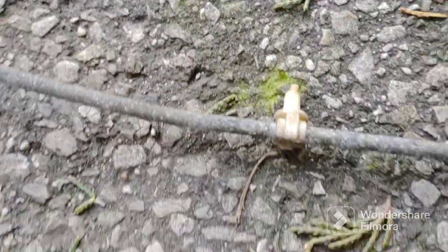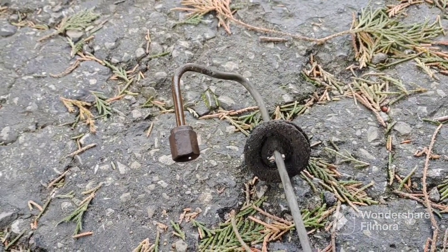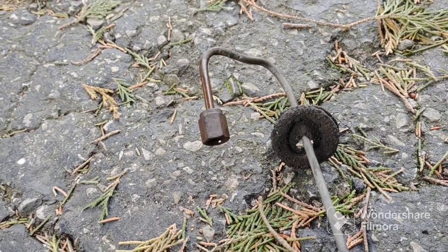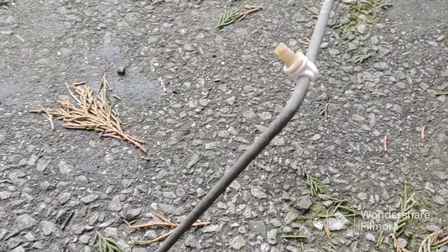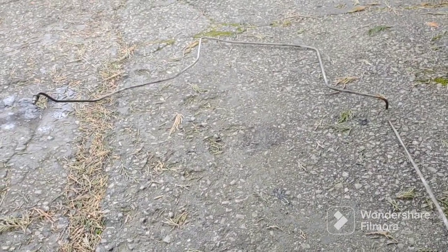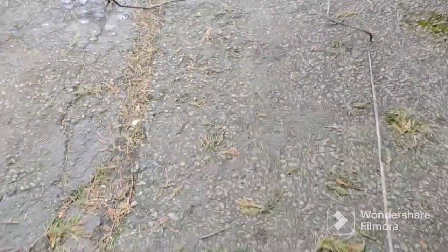What I think I'm going to do is change the line holders first, pop them all in, change the grommet, and then just start with a couple of bends — the one that goes to the rubber brake line on the right front. I'll do that little bend, because that'll be able to thread through, and then I'll do the main corner bend, shove it into the engine compartment, and use the tool to do whatever bends I have to do under the hood.